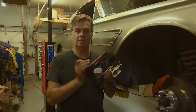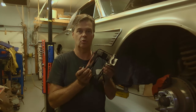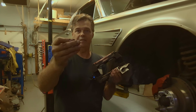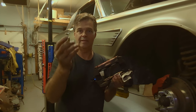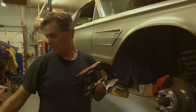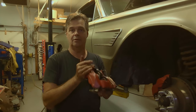really, outside of using air, grease works really well. Well, air works so well. Grease works the best in my experience. Just a brake line fitting with a grease fitting threaded into it, you'll have to tap that out some to fit that grease fitting in, but that's all you need. It's very cheap. And if you have a kit to put in, perfect, go for it.